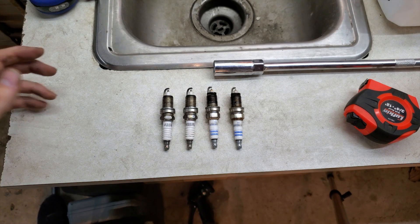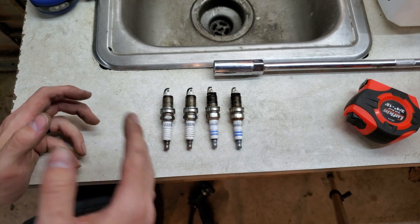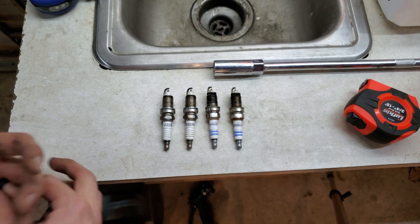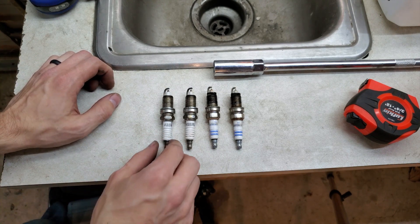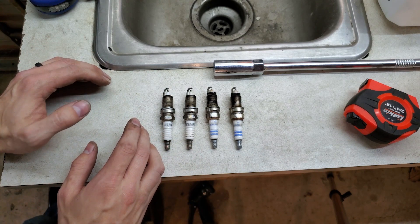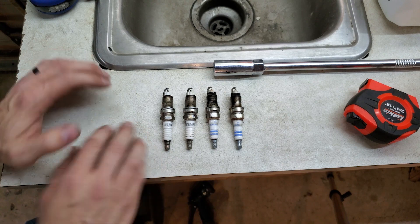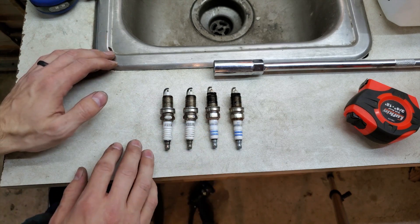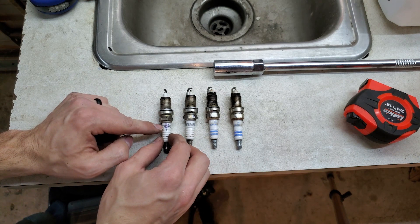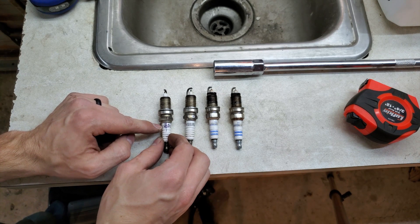This test is doing double duty for us because we also had to pull out all the spark plugs. As I went along, I had one more plug removed and the engine sounded different as it turned over because we're reducing the amount of load on the starter. I have the PC3 running at 10% more fuel than normal in all ranges — I just have a map of all tens. This spark plug here is cylinder one, and we saw cylinder one had a little bit different compression than the rest — about 10 pounds less than everyone else.